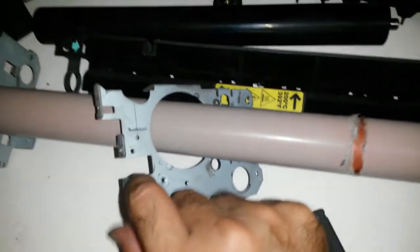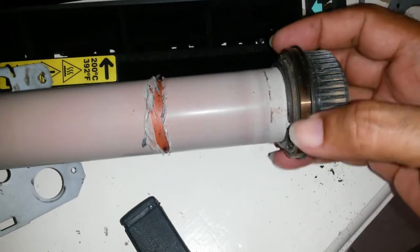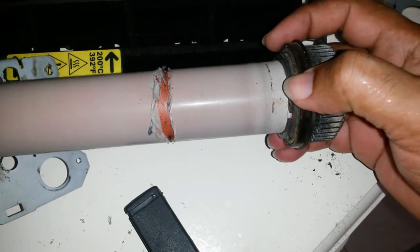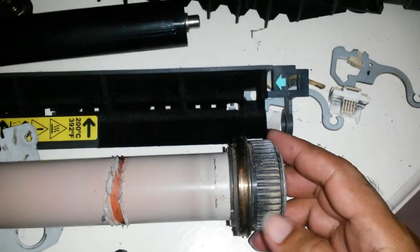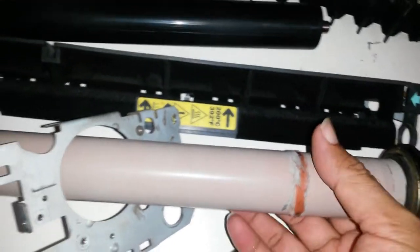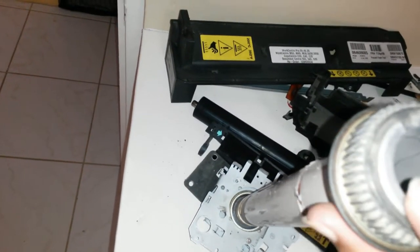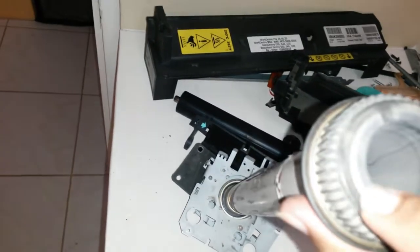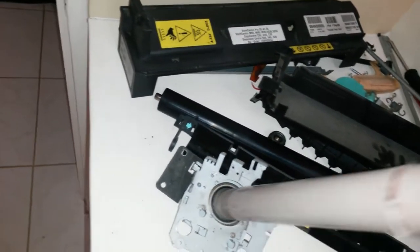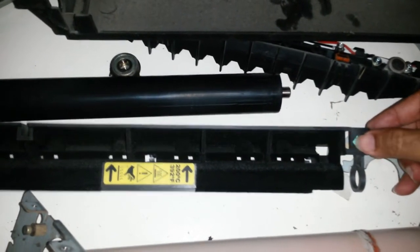Everything is now in pieces. This is the main end plate and the next end plate. There's a small screw holding things in place. This component has too much movement to be a bearing — I think it's a bushing. The gear looks like it's plastic, not metal as originally thought. Inside is just a shaft — possibly aluminum, though hard to confirm.